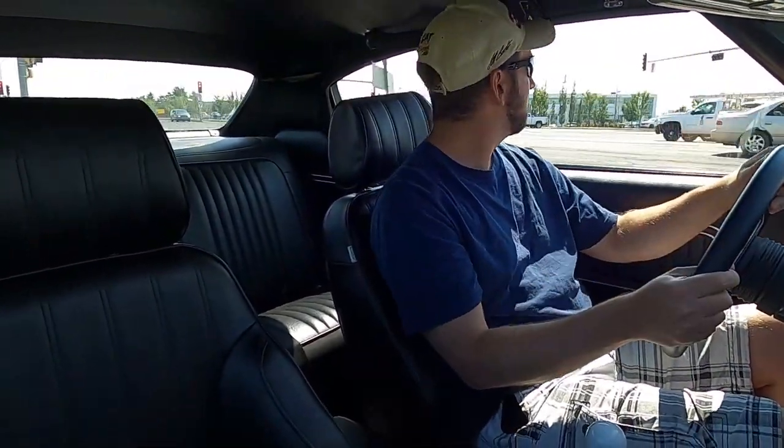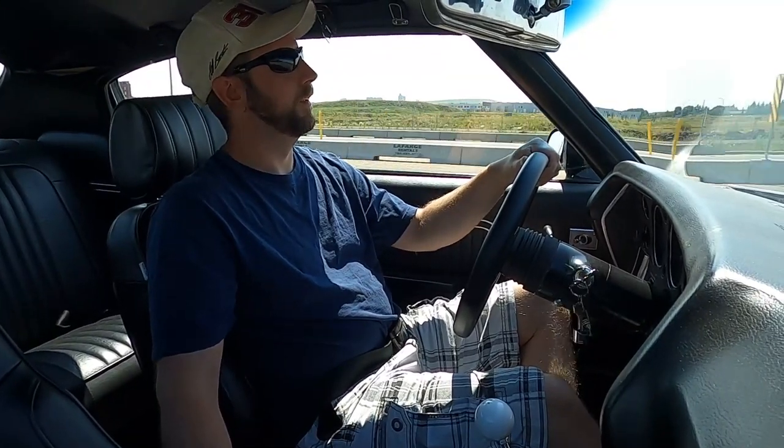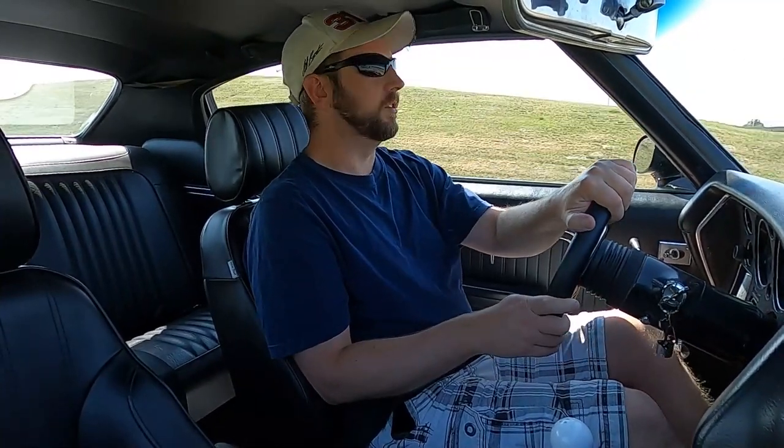I did the break-in process, which was three minutes forward and three minutes in reverse on jack stands, then went for a ten-minute drive. The gears were very quiet and I was very happy about that. I let it cool down completely, but then on the drive home it started to make noise — we're doing about 70 kilometers an hour and there's noise back there. We'll head up onto the highway, because as you saw at the beginning of the video, the loudest most annoying noise was when the car got up to 100 kilometers an hour or greater, about 60 miles an hour, so we'll see if it makes the same noise.